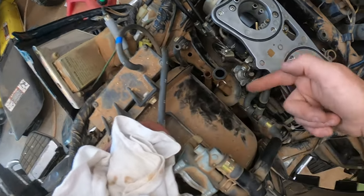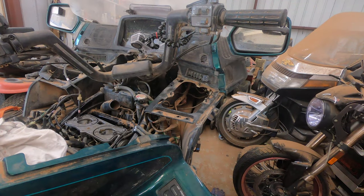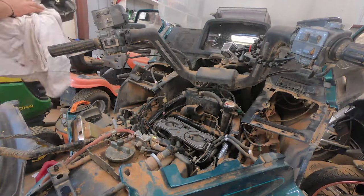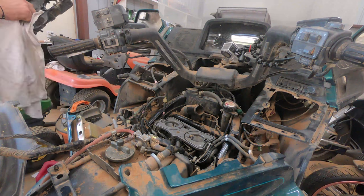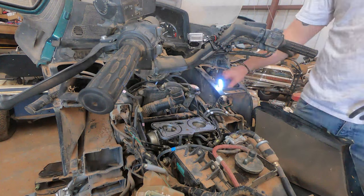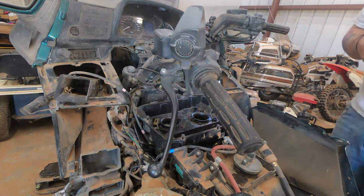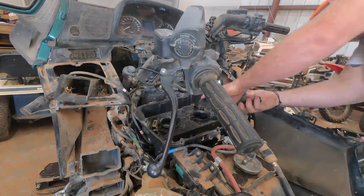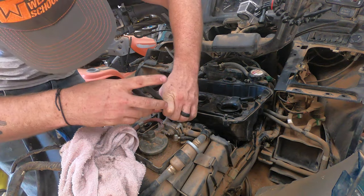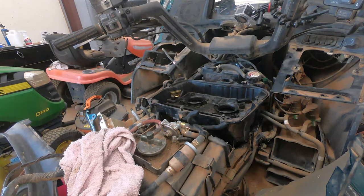Next, we have these hoses that are going to go to the bottom of the air box — these are a pain in the butt. That top one my finger's on is going to be the easiest one to get on first. If this is your first time doing it, plan on spending 30 minutes trying to get these hoses on all at the same time. I generally do the front-most hose first and then the other two. This is where those pliers come in handy — the ones with the circle end were a vital part of putting this back together. You can use the 90-degree or 45-degree, but I like to keep all of them handy and use whichever ones are working.